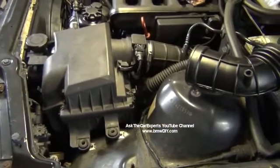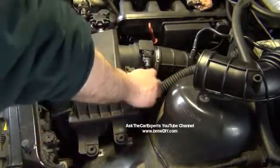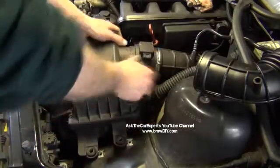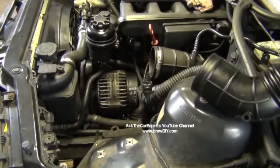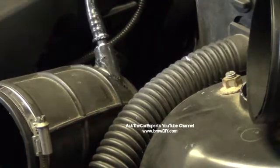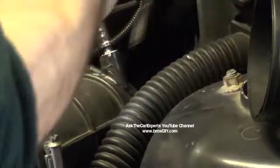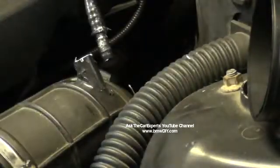I have the bolt removed and my clamps already loose from prior work. Disconnect the mass airflow sensor — you can leave it completely installed and take out the air box as a complete unit. This connection can sometimes be difficult to remove, but if you take a screwdriver with some white lithium on it and slide it into the boot, working your way around, it helps work the plastic piece free without breaking it.